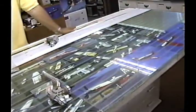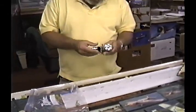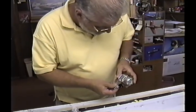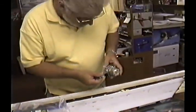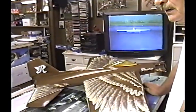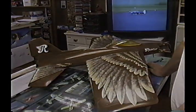And you got the side exhaust jet, which we're just miking up to see what Venturi size he had. 182. And the head is already shimmed on that? Looks like the head already has some shims in it. We're just comparing it with Les's. It is definitely the low time motor though. Oh, okay. Is that good or bad? No, good. Oh, it's definitely good.